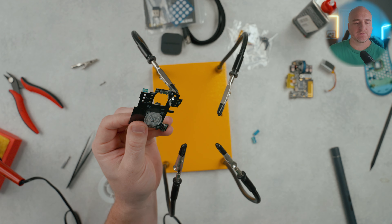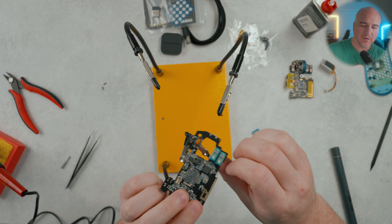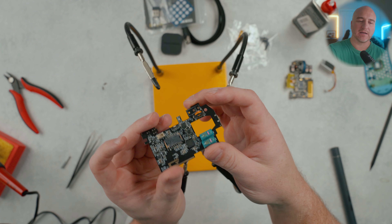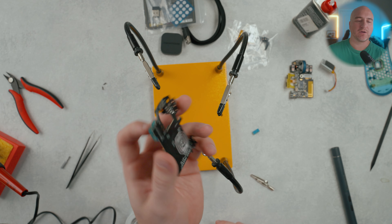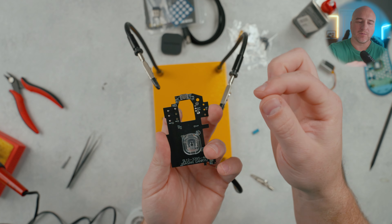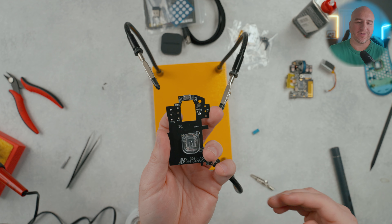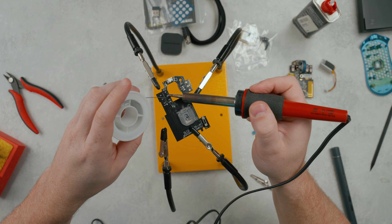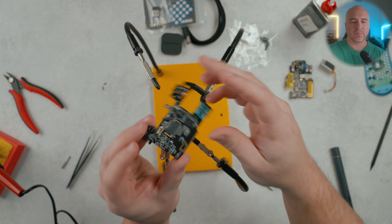When you're done, go ahead and check, make sure everything looks good, and make sure that the switch is still operating as it should. Now I'm ready to move on to the next one. Same thing: after I did solder that top lead, come in and check your work — make sure everything is laying flat and flush with the actual PCB itself. One thing you can do: if you do solder the first lead and notice it is kind of sticking up in the back or it's crooked, at this point you should have some contact on the actual PCB. Another way you can do this is one-hand it — push the switch in and hold it with one hand. Now that you actually have some solder on the board, your hand should be freed up and you can push the switch flat against the PCB as you touch that lead with your soldering iron to make sure it gets flattened out. Remove the soldering iron, it'll harden and then you'll be good to go.